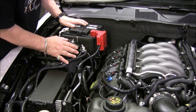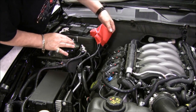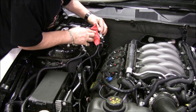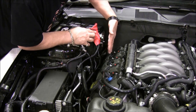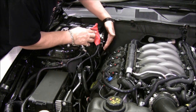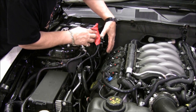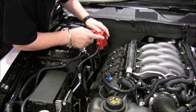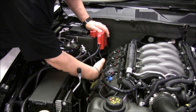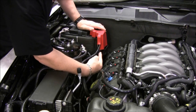Since there is a relatively large resistor pack on the 2013 5.0 Mustang, it's going to stick a little bit over to the side. So what we're going to do is move this battery over slightly so that everything can tuck in under the cover without having to really change any of the electronics. We will have to detach this spidering right here. Once it goes over, we're going to reroute it so it's nice and neatly tucked into one spot.